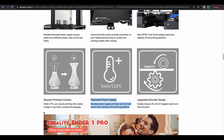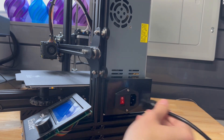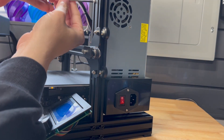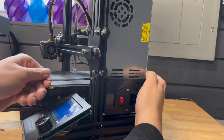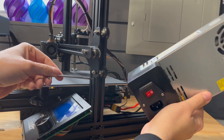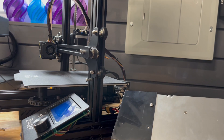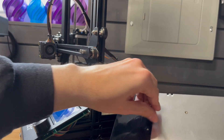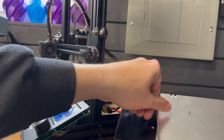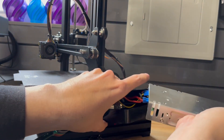So the only thing to do now is to open it up and see what we have. Lucky for us this is very easy to validate. First we're going to turn it off and then we're going to unplug it — safety reasons of course. Now remove the two screws that hold this power supply up vertically, and then we are going to remove this plastic cover, which is just held in with two screws. After we remove these two screws, this protective cover just slides off.